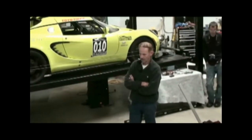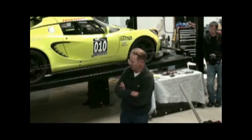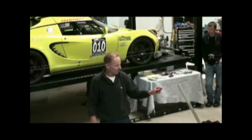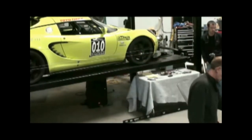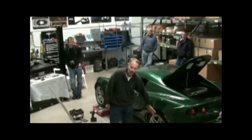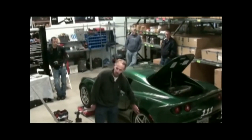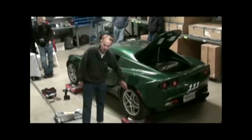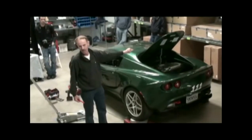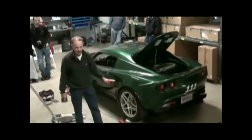The question is: what do you recommend for weighting the car down? You have to have ballast. That's something I forgot to mention — you have to have ballast in the car. If you sit in and out of this car up on scales and foot plates, this wheel with weight in it goes positive. We have about 2.5 degrees here; when he sits in it, it goes to 2.4. That wheel has 2.4; when he sits in it, it goes to 2.5. So this wheel has negative camber — you have to do it with ballast in the car.